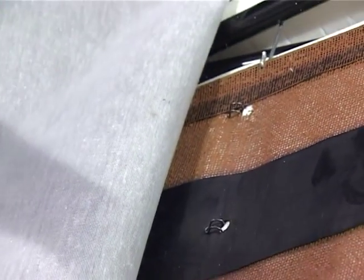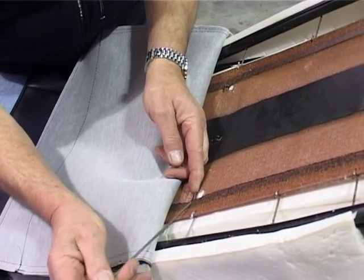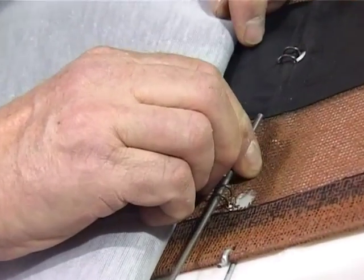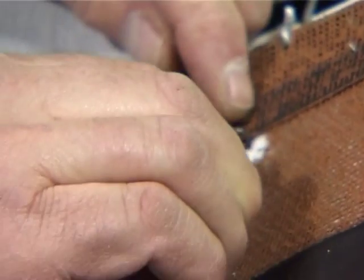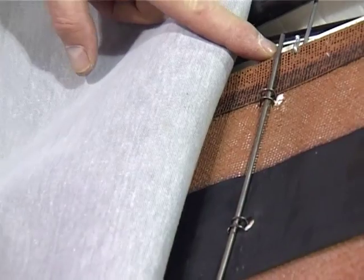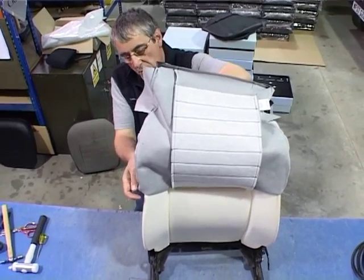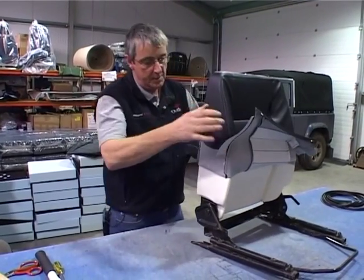Use your long retaining bar, and you need to slide it from one end first, whichever end suits you. Slide it through, and then grab and lift to the middle, through again. Make sure it's roughly even on the edge of the diaphragm. Done. Gentle pull down, down, and keep going until it's nearly there.